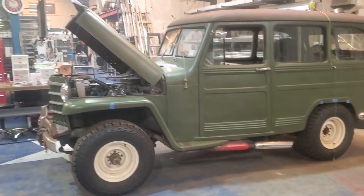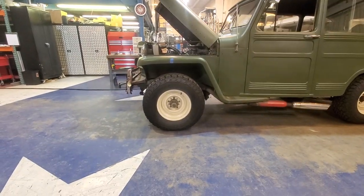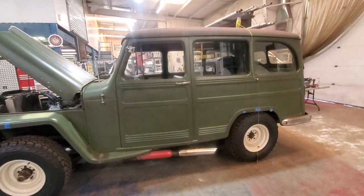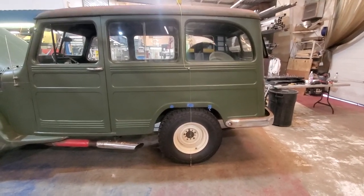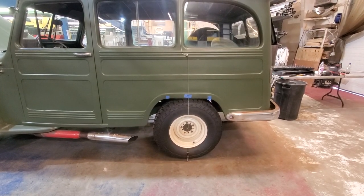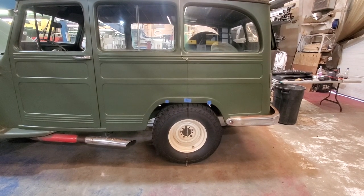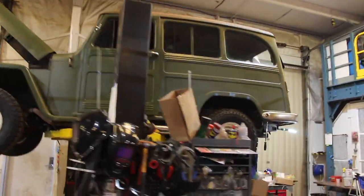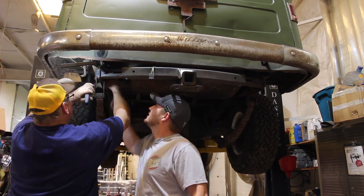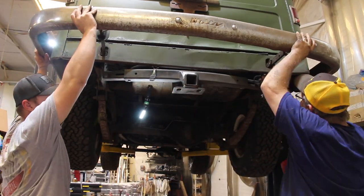We did all our measurements and we're going to maintain the wheelbase at 104.5 inches, which is stock. The front wheel looks fairly well centered in the wheel well. The wheelbase has probably grown by about an inch due to leaf spring sag and shackles moving outward. Once this gets on the new chassis, the differential goes out of play and load gets put on the TJ chassis, approximating the same motion due to the trailing arm position. Now that we have the body measured for wheel centering, we can begin disassembling the Jeep and pulling all the frame members off to get the body off.